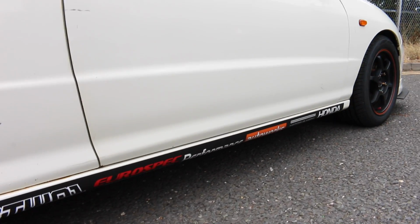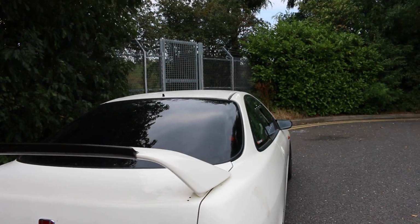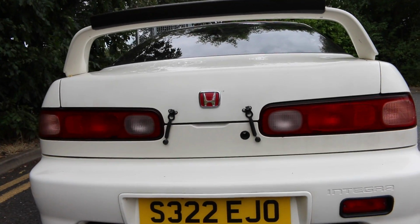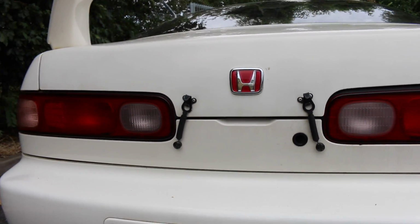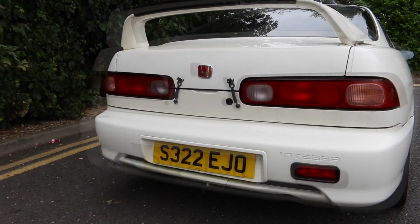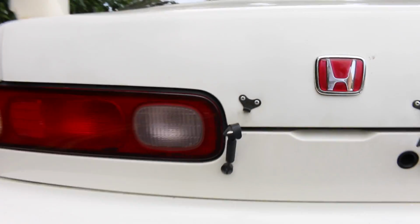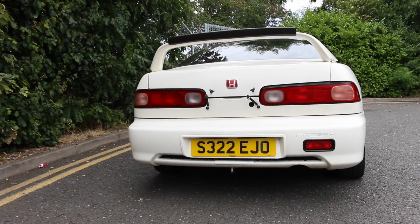Got the sponsors still along the bottom of the door sill there. And if we come towards the back, a tinted rear window, carbon fibre gurney flap. The rear trunk lid also held on by these latches for MSA scrutineering as well. Otherwise, if there is a fire or the marshals need to get to the driver quickly, the bonnet pins would stop them from getting to him. So these simply lift up and detach themselves like so. 98 spec rear bumper as well.